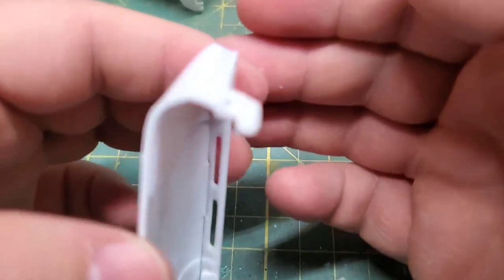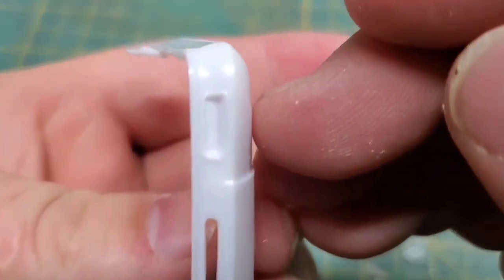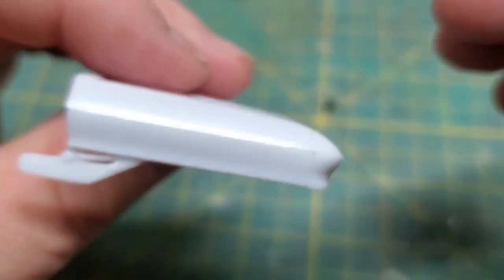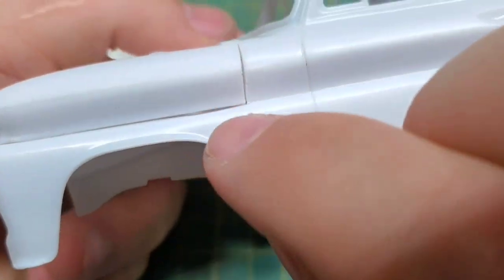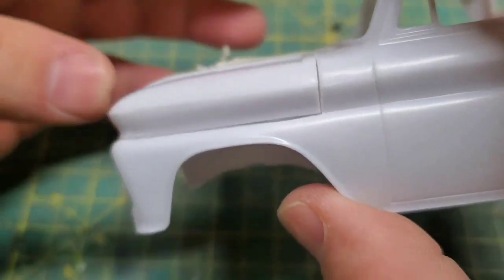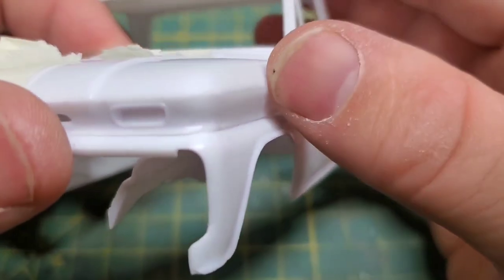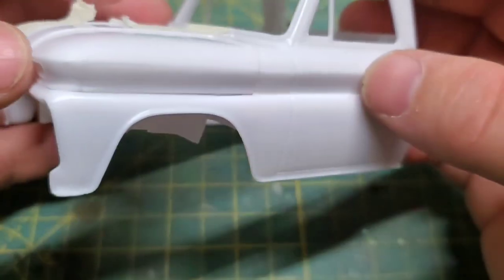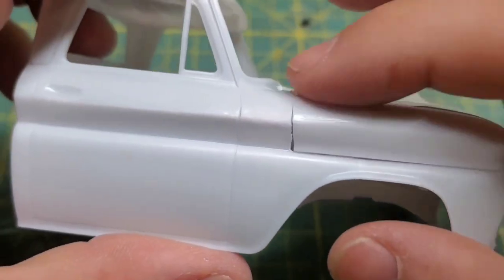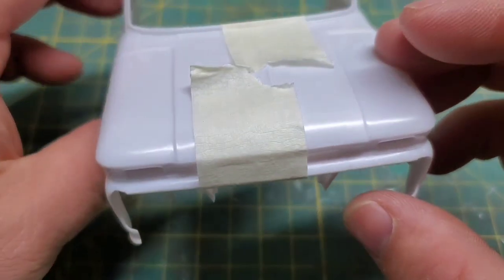You guys sit tight, because next we get a complaint about the hood fitment to the body, and it's not the hood's fault. There is a massive low spot right here. And I know it's not the hood's fault, at least I don't think it is, because it matches these body lines rather decently. On the other side over here, it doesn't match the body line at all. So what I need to do is sand on that bottom rail of the hood to pull that body line down.